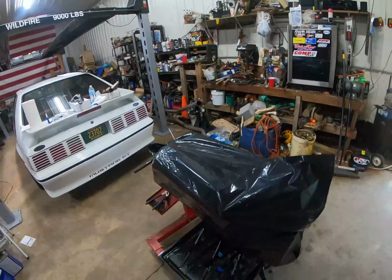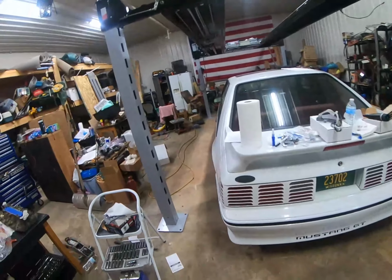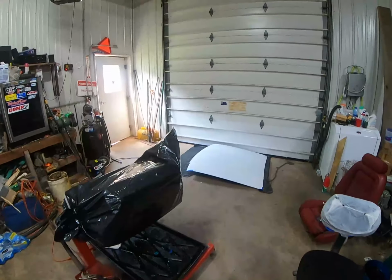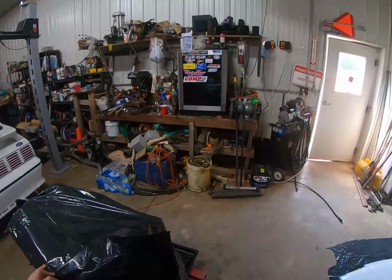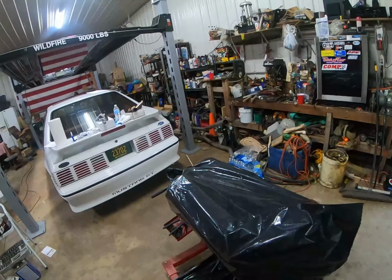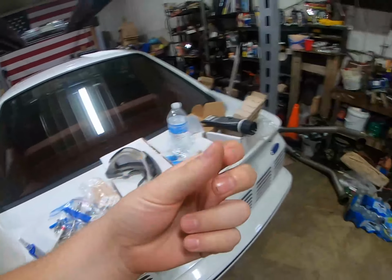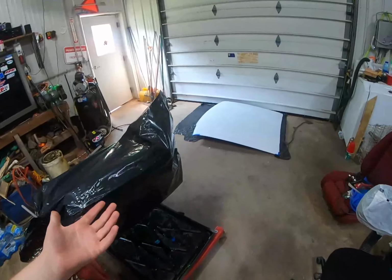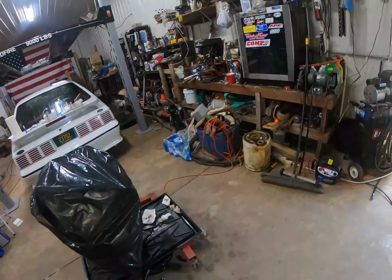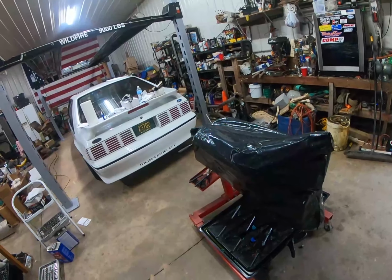And what do you know, it patterned really well. I was like, oh, this is perfect. I did the mid lift correctly, and when I paid attention to my 90 degrees really closely, you know what it came out to? It was like 7.09 something, and we had 7.1. And that was with me using calipers versus just eyeballing that tool and the turns, so it's probably just a difference in that. Basically, both methods work, is what I'm trying to say. Both methods get you darn near the same result.